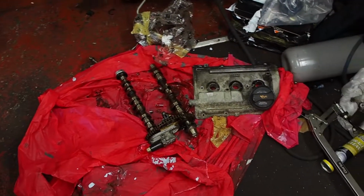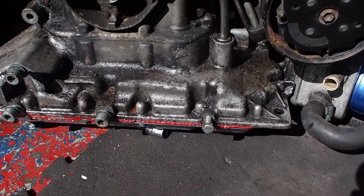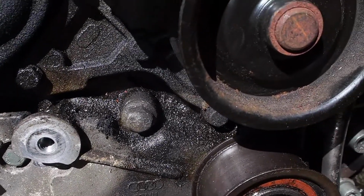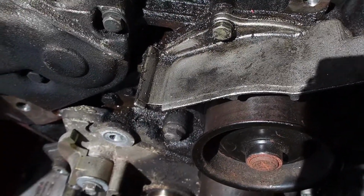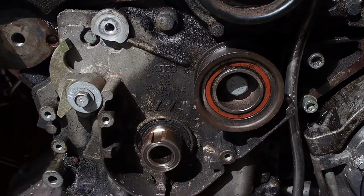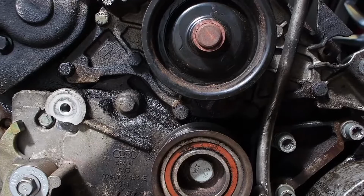The oil leak I've been fighting on the sump might well be coming from higher up, so I'm planning to change everything. You see it's all oily by there. Now a lot of this will be runoff from when I changed the power steering pump and it dribbled the fluid down, but you can see the crank seals weeping there, so I'm going to change it all.